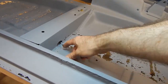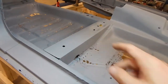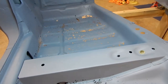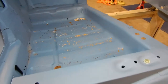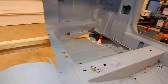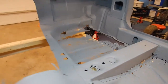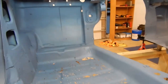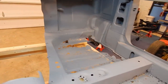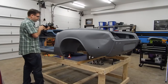We've got some pitting and holes in the support bracket here, which I was really hoping were going to be okay. They're pretty simple pieces, so it's possibly repairable without replacing them — depends on what we look at. This one's not bad. The one on the passenger side is really a lot worse and will probably need to be replaced; it's got more pitting on the bottom, and even on the top side where the bolts go, it's pretty rusted out. The front floor pan is really where the water sat, more so on the passenger side. It looks like the passenger side took the brunt of it, but all right — it's going to need some floors. That's not so bad.